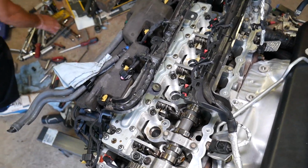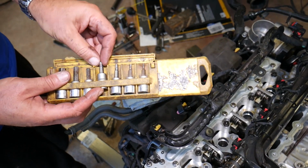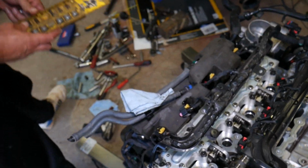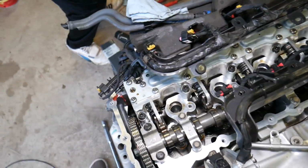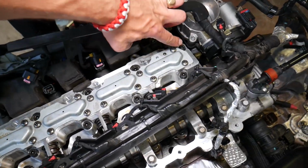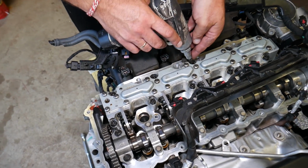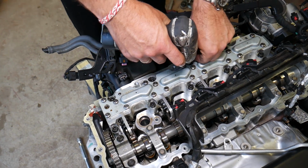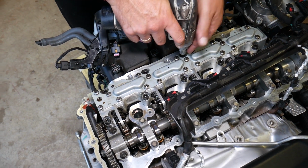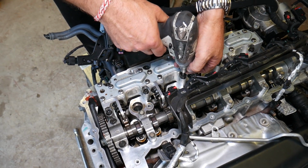Now, here, guys, we need to get an Allen wrench and start removing that block. We need a 6mm Allen wrench. Again, all the tools and parts will be listed in the description of the video below. This bolt here, guys, and the bolt right there will be the last bolts to remove because they have guides. Otherwise you can mess up the threads on the other bolts, and you don't want to mess up your cylinder head, guys.